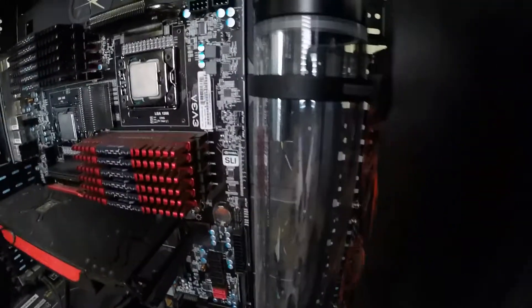I need to at least be ready for the liquid cooling. I gotta buy fittings. I don't know if I'm gonna buy hard tubing — which is basically the same material as this clear plastic — or rubber tubing. I've had rubber tubing before, but the coating actually comes off and creates a film on the inside of the whole loop. Some bacteria grows in it or something. Hard tubing is more work for cutting, making sure measurements are right, and fittings are different.